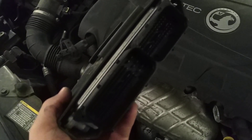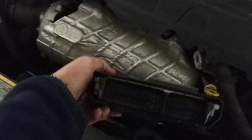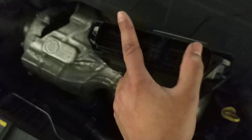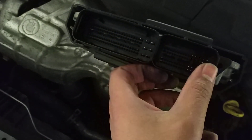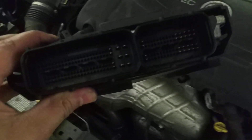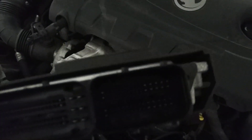So that's the ECU off. Just take extra care when you're taking the block connector off the actual ECU. The block connector is these parts here. When you take those plugs out, make sure they're fully open before you pull them out, as you can damage the pins on here which will cause running issues. Once you've got the ECU off, always give a visual inspection to the actual pins — make sure none of them have been bent.